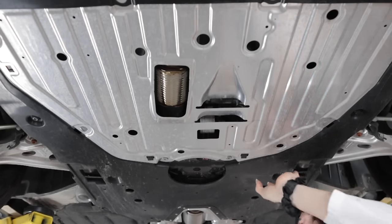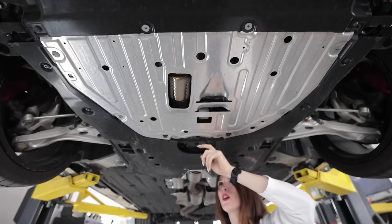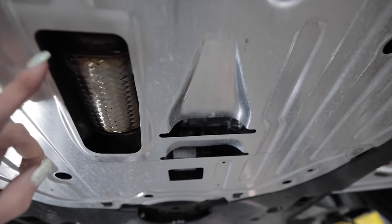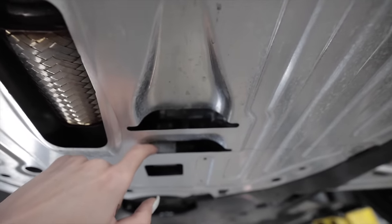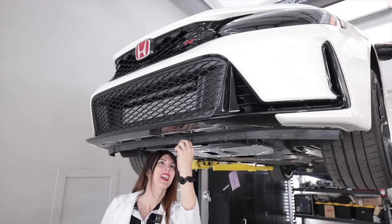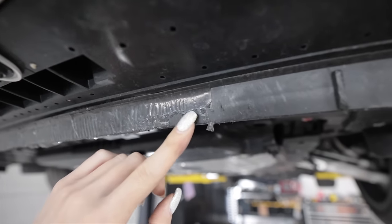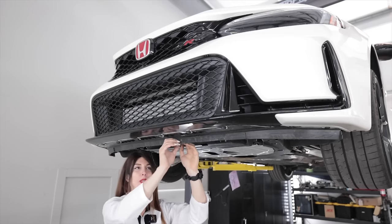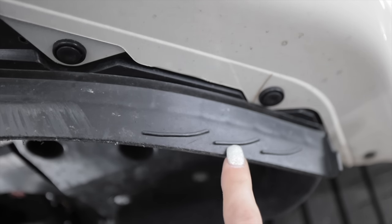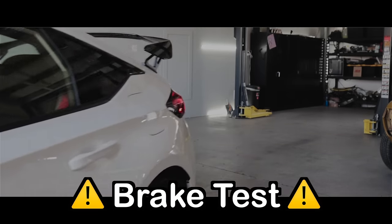They use aluminum for the splash shield under the engine — a nice thick plastic one also with aluminum riveted to it. Underneath the subframe, there's easy oil drain access right there. There's a little cutout around the flex pipe on your downpipe, and you can see part of the dog bone mount. Those vents — it's got a replaceable little adhesive vinyl shield protecting the lower plastic air dam, so if it gets scraped up, it just scrapes up the replaceable part — like a tear-away for a helmet. Look at these tiny little ridges to direct air up.